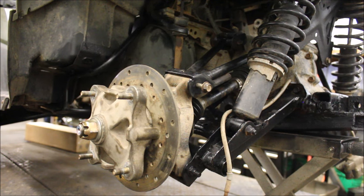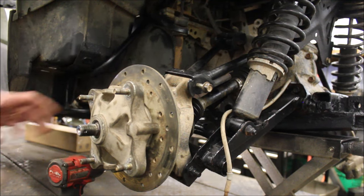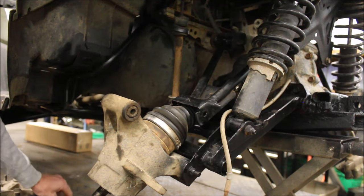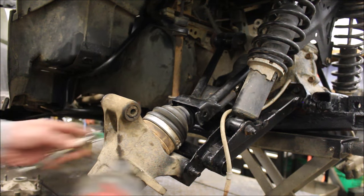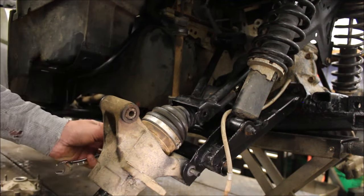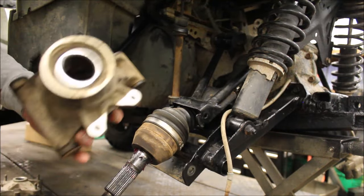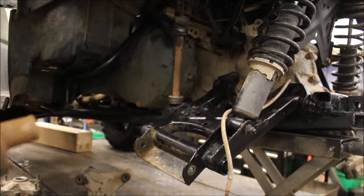So I'm gonna go ahead and rip this apart. I had it apart once before so I could find out what was going on. I just want to take this off so that's out of the way. It'll be a lot easier to put the axle shafts in place. This is a 2009. I'm actually liking these. They don't have the stupid bushings like the older ones have. Pull that out. I already greased up the wheel bearing. Throw this up here, pull that out.